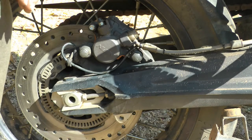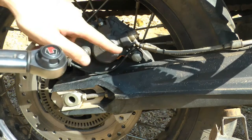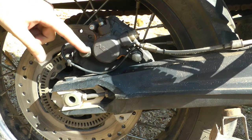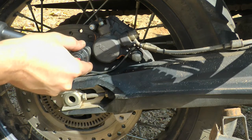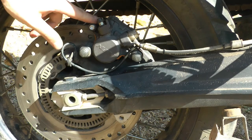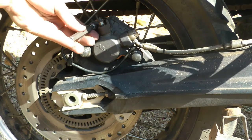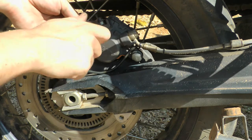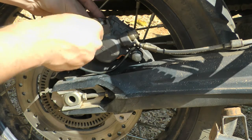To start with the torque wrench: the 14mm bolt is 27Nm. The 12mm bolt is 22Nm. The pin itself is 18Nm, but you can get it in most of the way just by hand and it should go in very easily without any resistance.